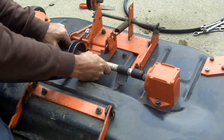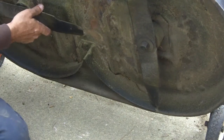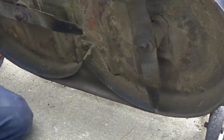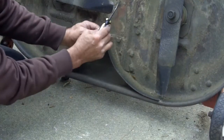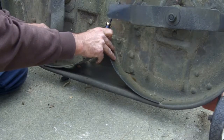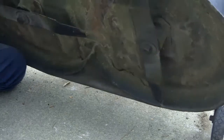Now, because of taking this off, I have to make sure that the blades are still in time so that they don't hit against one another. So let's flip it over — it's perfect. These blades can hit against one another, they overlap. If we put that screwdriver right there, you see that blade hits it — they overlap so that it doesn't leave a space in between the blades, and so that the mower deck can go straight under the tractor instead of having to be askew. Most two-blade decks don't run perpendicular to the tractor, they're a little crooked.